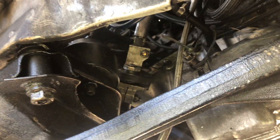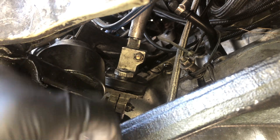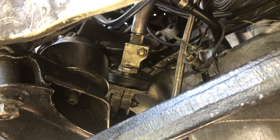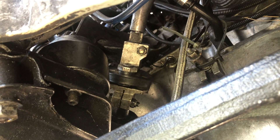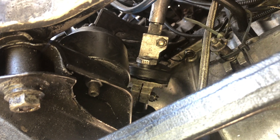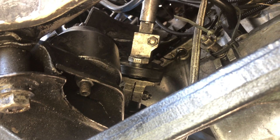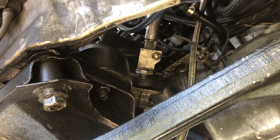It's been about 20 minutes and this thing is a hassle to get in. Next time I put on this bushing, I'm going to start by putting it on the rack first and then slide it up into the top shaft portion, because sliding the rack around is just too hard. I'd rather beat on an extension to drive it up. It might not make complete sense, but I'll probably show it in a future video if I convert to the E34. At least it's on — I tightened everything up and she's good to go.